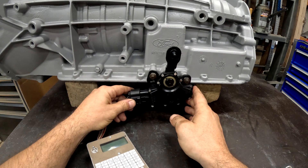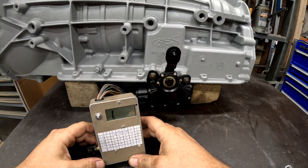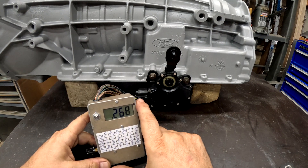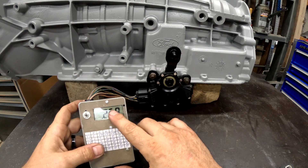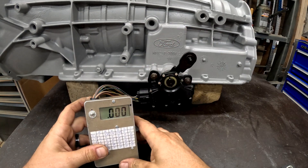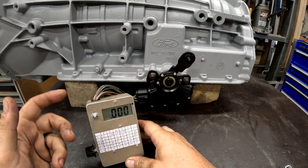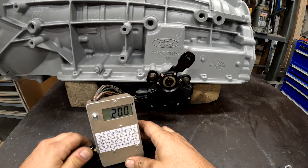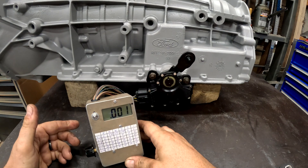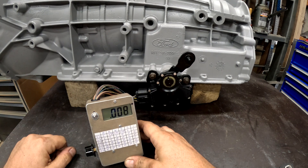My gizmo — all I do is plug it in and snap it. It runs on a battery. I have my table showing expected results and a rotary knob on the side that connects all my pins. Starting in park: 2-3 is expected to be closed — it is. Zero is closed on this meter, one is open. 2-4 should be closed — it is. 2-5 should be closed — it is. 2-6 closed. 9-11 should be open — it is. And 10-12 should be closed.